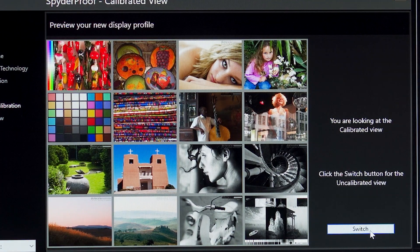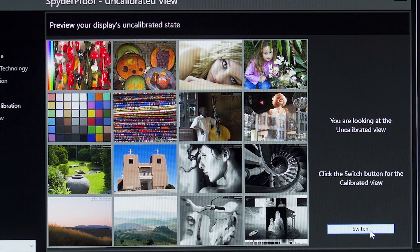I was honestly quite surprised with the results. My calibrated version was a fair bit warmer than my uncalibrated. Now that is based on factory reset settings, not necessarily what you've been using if you've made adjustments to your monitor in the past. But what really surprised me is that one of the sample pictures is Datacolor's colour passport chart with all the different coloured squares, and you can see a clear difference — the reds, oranges, and blues are all far more saturated in the calibrated version. Which potentially means that if I've been editing pictures on that uncalibrated monitor and upped the saturation on reds, oranges, and blues, they're going to look oversaturated to anyone viewing them on a calibrated monitor.